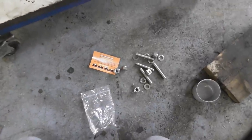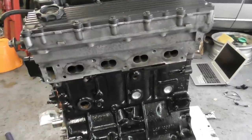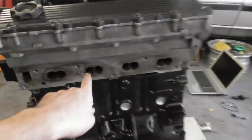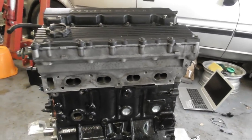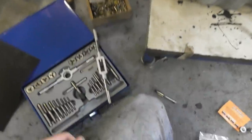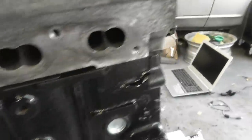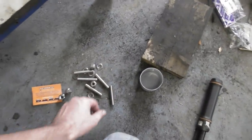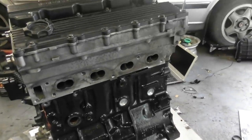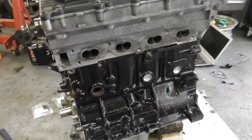I've had my cup of tea and painted the top inlet, but I'm waiting for the paint to go off. While I'm doing that, I'm going to fit some studs to the exhaust side of the cylinder head. These threads are almost always knackered. You can already see one of them has been helicoiled. So I'm going to run a tap and die in and see how many threads are remaining on the others. That's a result — I've just put that M10 tap in and out of the other four and they're perfect. Clean as a whistle and no maligned threads. So I'm going to put a bit of copper slip on these and put them in.